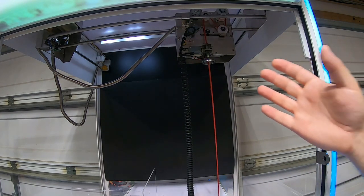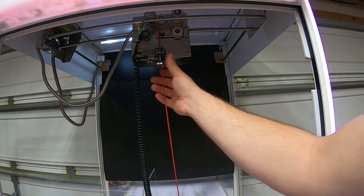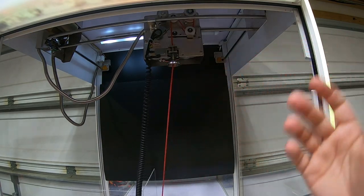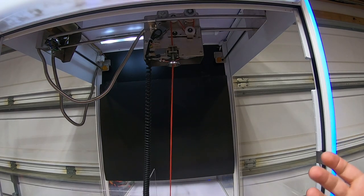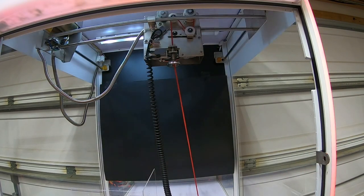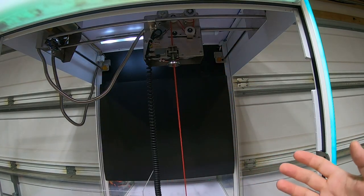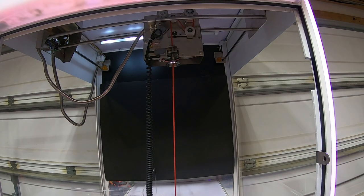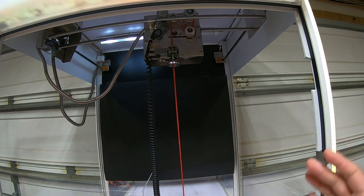Initially I was messing around with the switch, and that's how I got it to be able to move around again. Before that, I wasn't getting any action at all — it wasn't moving. My buddy Anthony Hastings, who joins us on our Wednesday live streams, said he'd had an issue like that before and the problem was the main board. He actually sent me a couple main boards to test in this machine. Because I figured out the switch issue first, we know the main boards are good. I tested Anthony's boards anyway — all was good, no changes. Definitely not a main board issue, so I'm going to have to send those boards back to Anthony.